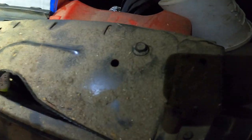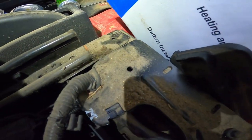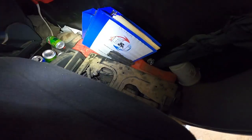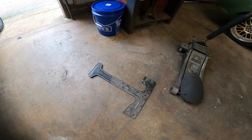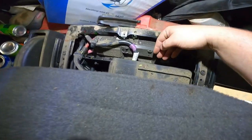After removing those bolts, slide the driver's seat all the way forward and lean it forward. On the back there will be two 8-millimeter bolts — they're supposed to be three but I think I'm missing one, so I'm going with two. Remove those bolts and the whole plastic or metal middle section will slide out.